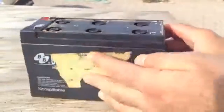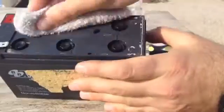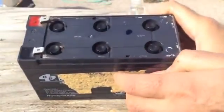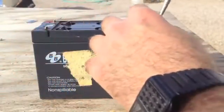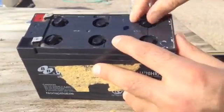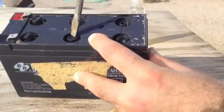Got a little dirt — go ahead and clean that up. Now, I have not tried to charge this battery in the last five years, so it's okay for me to open these caps. But if I had been messing with this battery and trying to charge it before I refilled it, these caps would be very dangerous. They could actually spit out any liquid that was in there when opened — there would be a lot of pressure, potentially, if this had just been charging. So these caps come right off. You can wear gloves if you want — I find they're really difficult to manage with gloves on. You can pull these caps right off with your fingers or with the screwdriver. You're going to want to save them.